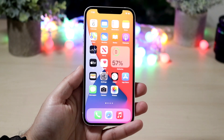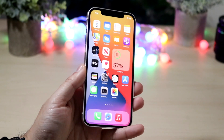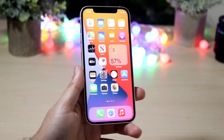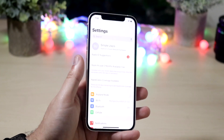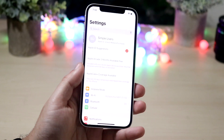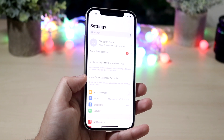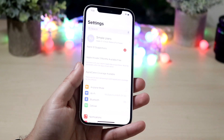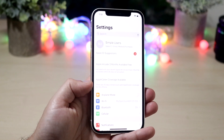Now let's say you've enabled all those things and it's still not working. Typically what happens is that you may have just updated your iPhone, or your iPhone updated by itself, and it has a faulty update. If you update your iPhone to the latest version of iOS, sometimes it may have issues that actually stop Wi-Fi calling. We see this time and time again — it's not a big deal. Apple pushes out an update every couple of weeks, so it may be a temporary problem, or you can always downgrade your phone to the previous version of iOS.